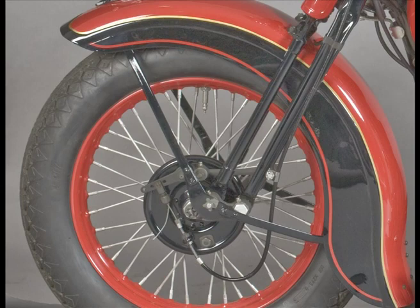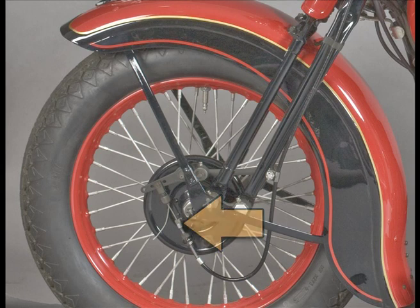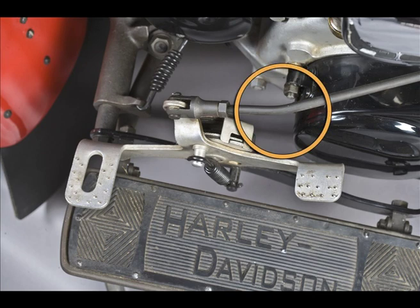Lower down the brake cable, we have another cable clip under the brake anchor bolt, fitted with a castle nut and a clevis pin, another ferrule, then the adjuster, a special ferrule with a felt washer to stop water getting into the cable, and finally it's terminated under the special clamp attached to the brake operating lever. This is the 1935-36 front brake with the adjustable brake shoe pivot stud. The clutch pedal is 1 year only for 1936, with its 1 year rod. It's kicked out to make room for the longer police generator, not fitted on this machine.